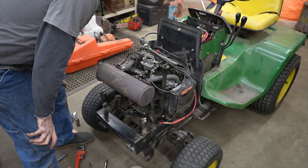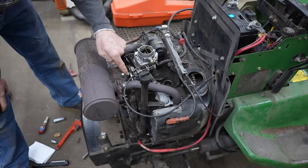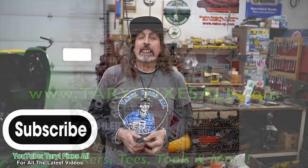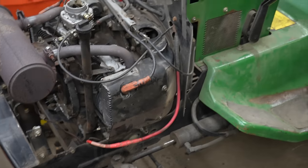Now I just got to put it all back together. So there you have it — got the timing set, got the OEM points put in there. I'm going to put some thread locker on there now to make sure that doesn't move, and put the timing cover back on. So there's a little update on this baby. Subscribe to this YouTube channel if you haven't already, check out our web store, follow me on Facebook, Instagram, and TikTok. And as always, there's your dinner. Update video — we'll see you next time.